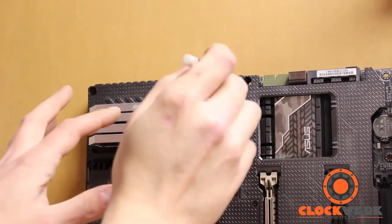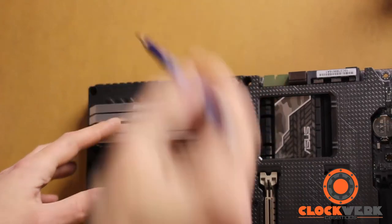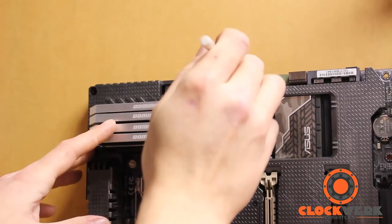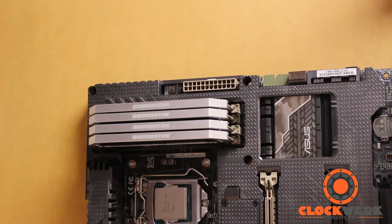First, what I did was go to all the holes on the motherboard and try to get as much of a circle as I can drawn to the motherboard tray with a pencil that I kind of whittled into a point with a knife, so it'll fit through there long enough. Mechanical pencil isn't working, and I didn't want to stick the drill right through the motherboard. Now I'm going to take the motherboard tray out, drill out all the holes in the center, and put the standoffs in.